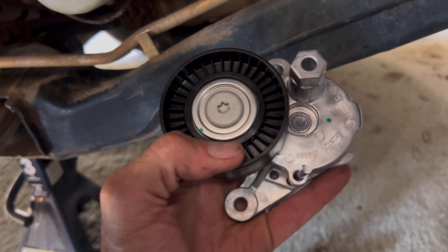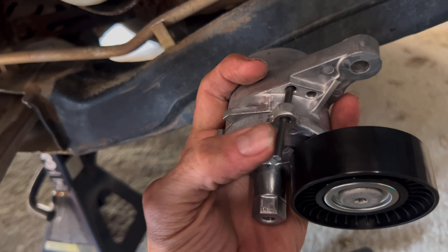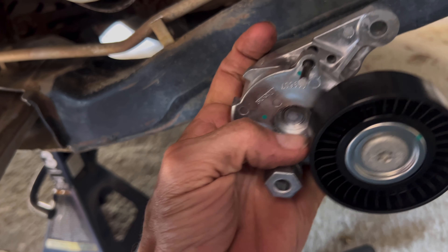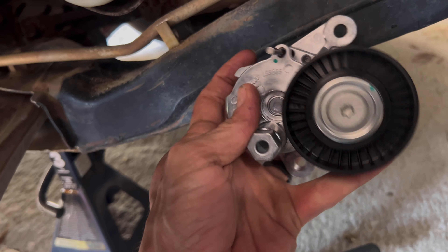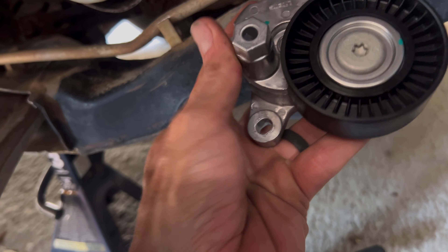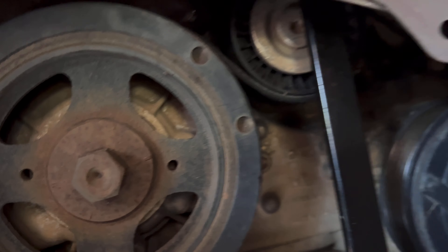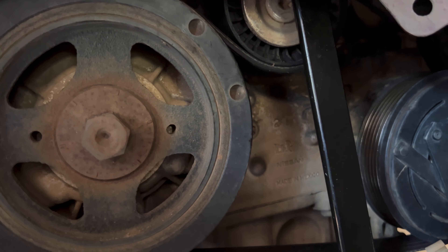Here's the part we're going after, and it's actually installed like that. The one on your car does not have this — that actually holds the tensioner in place so you can get the belt on before pulling this pin. What you want to grab is this right here, and that's a 17 millimeter. You can see how I have this Harbor Freight bar on it — all you got to do is pull and it gives you some slack, and then you can take the belt off.